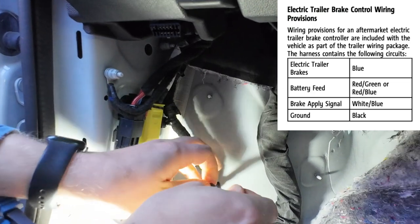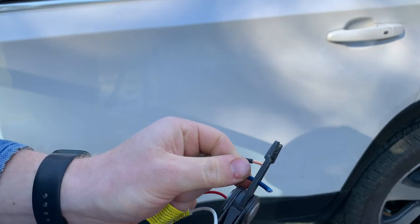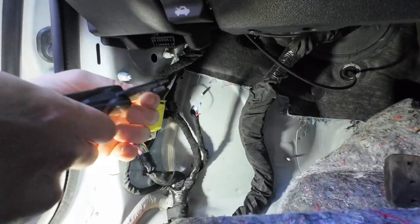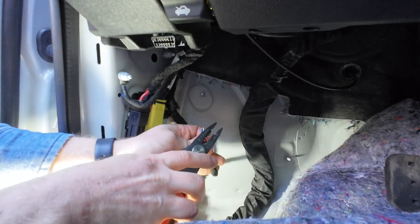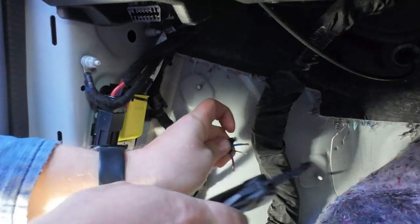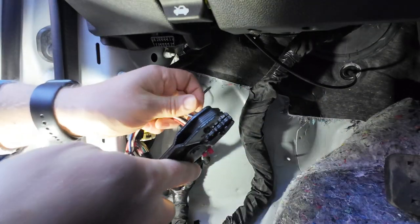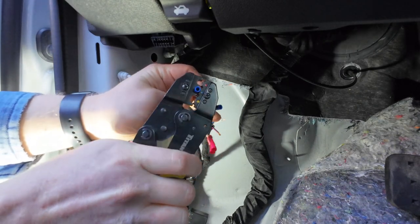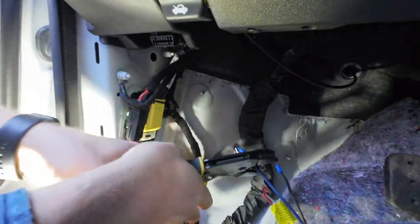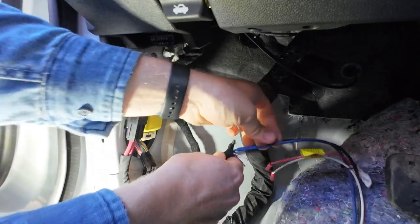Let's see what we've got: there's a blue, a white, a black, and a red. I'm going to go ahead and strip these wires and install my crimp connectors on this end of the harness outside of the vehicle. I'll go ahead and strip the ends on the vehicle side too. I like using these ratcheting crimpers because you can get your tool lined up and it'll hold it in place for you — you don't have to worry about dropping it. It's locked in there, then I can just slide it over the wire. That should be crimped down good. I'll put a link to these crimpers in the description if anybody cares.